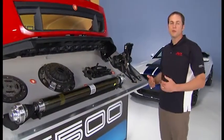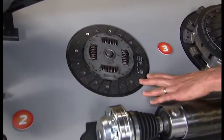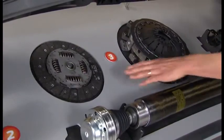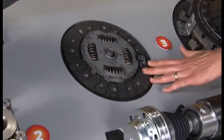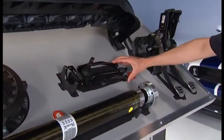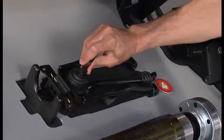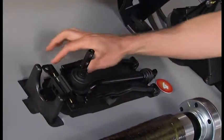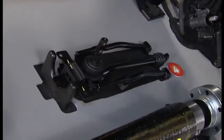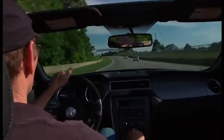The clutch was revised to improve the drivability and the ability to handle the torque and the shift feel. With the clutch disc and the pressure plate, the clutch disc was increased 10 millimeters to 260 millimeters and the friction material was revised to handle the heat and the torque and the speeds necessary to go 200 miles an hour and apply over 600 foot-pounds of torque. This is our shift linkage on the GT500. We've revised the ratios — the geometry of the shift lever as well as the bushings — to improve the feel. The critical aspect on the shifter and the clutch system is that those are the two components that the customer feels every day, so there's a balance between the clutch pedal effort and the shifter feel.